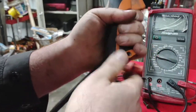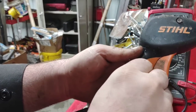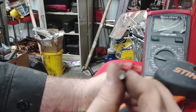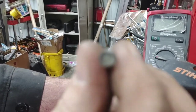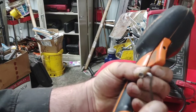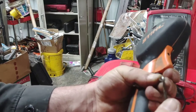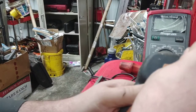These are sometimes a bear because they don't always line up right, but there — now you've got it lined up right, you can stick your screw in and stick your other screw in right there. If your screws are bunged up like this one is slightly — it's got a little crap in it — I just take a pick and pick that out a little bit, let the dirt fall out, blow it out. You should be able to stick your screwdriver in there without a problem. Now you can tighten up both these bolts.